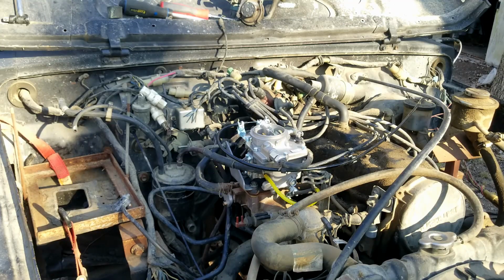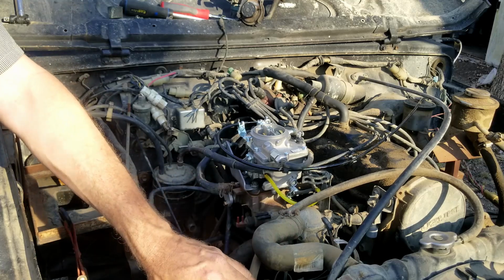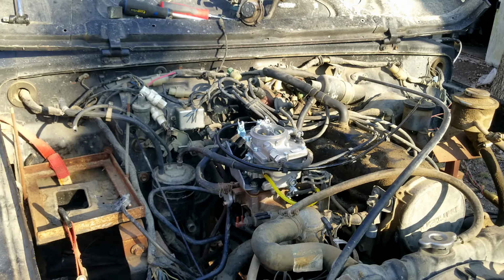All right, the last couple of steps. Check all the bolts, clamps, vacuum plugs for confirmed installation. Top off the radiator with coolant if too much was lost during the installation. The certified machine carburetor will come properly adjusted, ready to run. For proper adjustment, a wideband O2 sensor is highly recommended. Other methods may produce good results, but proper air-fuel ratio can only be achieved with an AF gauge.